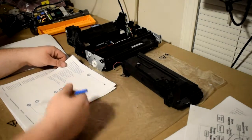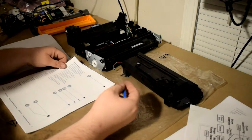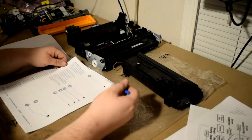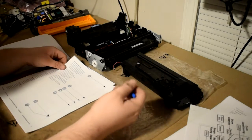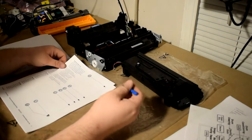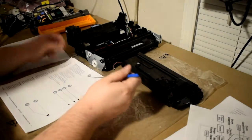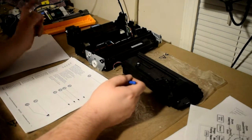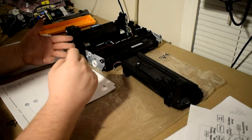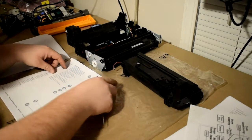But this is something you get with experience. A regular seasoned technician could spot these and go, oh, that's a this or that's a that. If I see a print defect that's repetitive, I will check not only the part where I think it is, but I will check the other parts in the printer just to be sure I'm not looking at multiple issues or something else is worn, because I've had instances where a staple went through a printer and it caused only one defect, but it damaged the toner, it damaged the transfer roller, and it damaged the fuser. It was one folded staple that had gotten dropped into the unit. It happened.